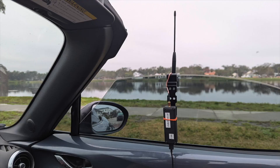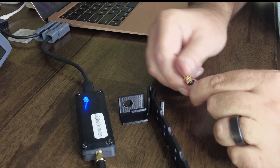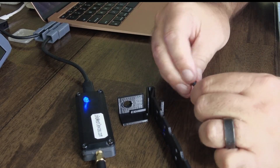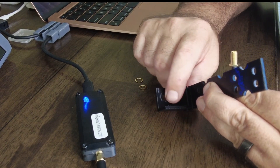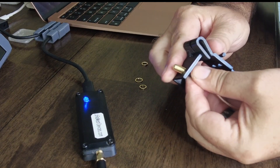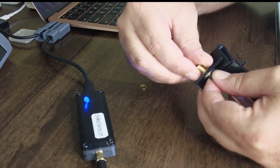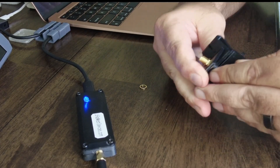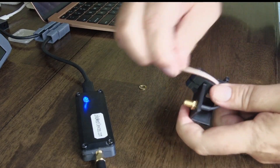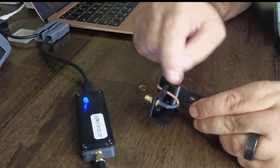You can see it clipped onto the window — you can roll the window up and down and there it is. What you do is get something like this, there's a link in the description for it. This is just a little pigtail or extension cable. You take that cable and put it through there, and you'll see it's a little bit angled so that it stands a bit more to the outside — the antenna points a bit more to the outside. When you connect it to a car window, it's nice to have the antenna actually pointing a little bit more upwards. You run this little cable through there and then through there — that's the part that actually goes onto the window.